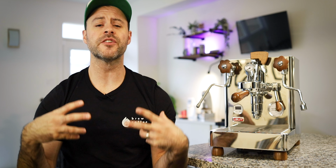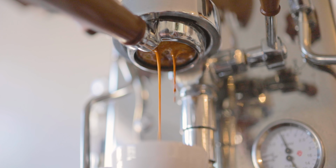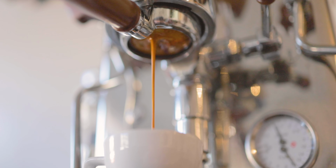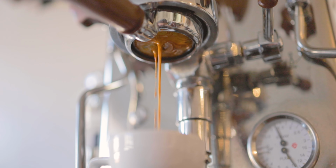The LCC also boasts a programmable PreInfusion feature. While not a true PreInfusion, it can be a great option for those wanting an ease of use experience. This is done at full pressure for a handful of seconds, but then shuts off the pump to allow the water to soak the grounds. Then the pump starts back up again to finish the shot. All of these variables are programmable.